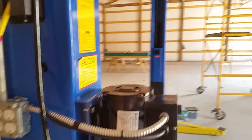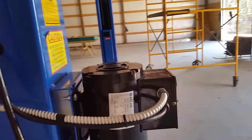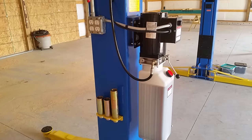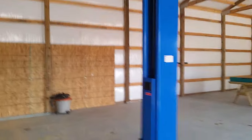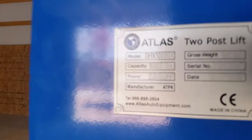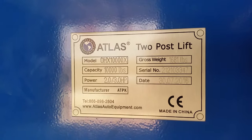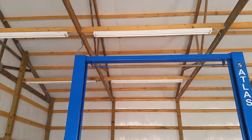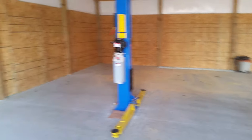When you're letting down the lift — I don't know if I explained it the other day — when you push in on this side, there's a cable on the other side that unlocks the other side, which is pretty neat because you don't have to try and go unlock that side and then come hold this side. This is a 10,000-pound lift, extra high, extra wide. We got it from Greg Smith's. It's an Atlas. It does have the bar on the top to stop the lift once the cab of the truck hits it — you'll never have a car on here that will hit it. Even my truck won't hit it, and my truck's pretty tall — probably about six-three from the ground.